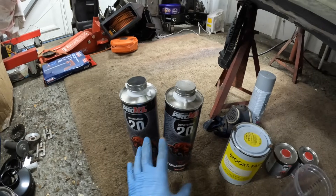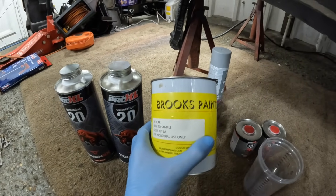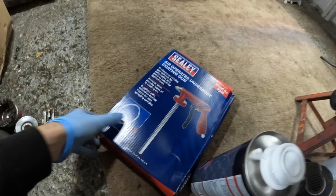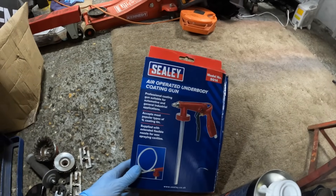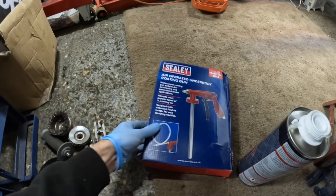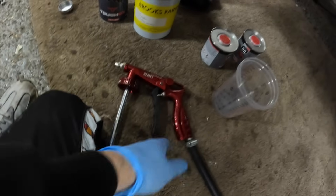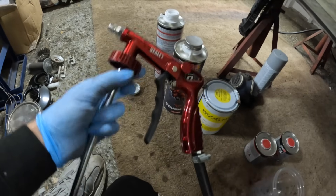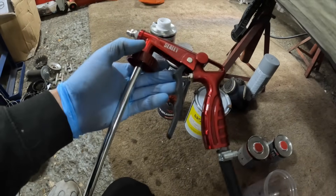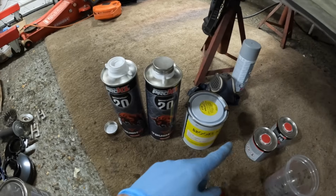The mixing instructions say this product is colourless so it requires tinting before use. Add 120ml of solvent-based tinter of your choice followed by one full can of Tough Ox hardener. I've got two cans and I'm not quite sure how far they're going to go. I've also got a litre of my beige paint which was colour matched to the car, and two small hardeners. I've also purchased a Sealey air-operated underbody coating gun which runs off the air compressor. I had to chop off one end and put a jubilee clip on to fit the spray nozzle.